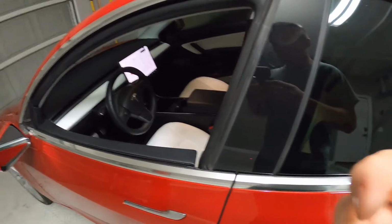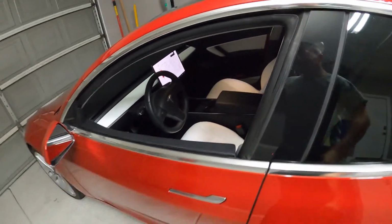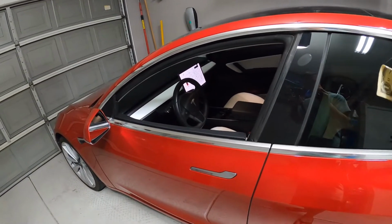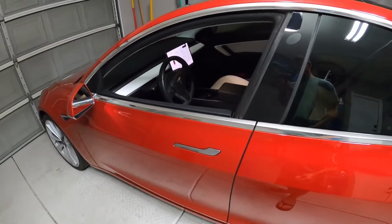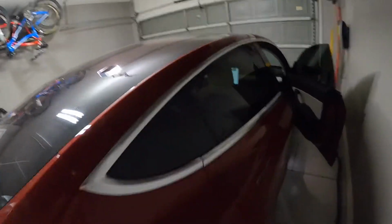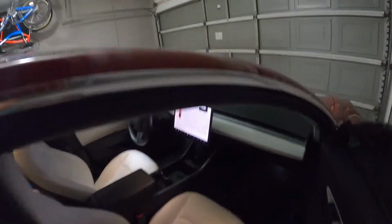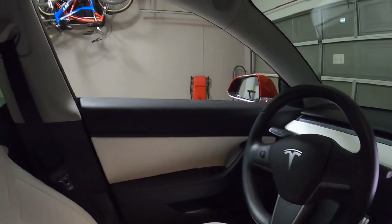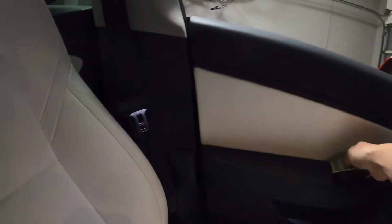So what I'm going to do is just show how I check this, and I'll kind of show where this was before I started adjusting. Where I ended up is on the front adjuster, I put it back to its original position, factory position. The rear adjuster, I ended up with 6 counterclockwise turns. That's about as far out as it could go without the stud getting loose.